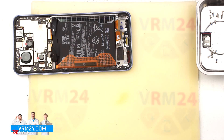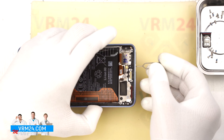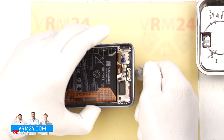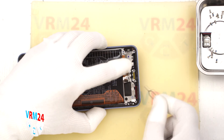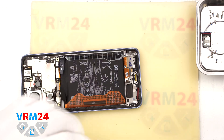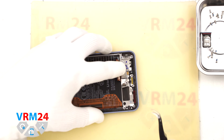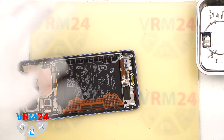And here comes our usual microphone opening test. The microphone hole is located in the display frame and has an L-shaped channel. It is covered on the inside by a mesh or membrane. The microphone itself sits on the subboard behind it, so if you insert something into the microphone hole, you are unlikely to damage either the microphone or the mesh. The fingerprint sensor and vibration motor remain in the display frame.